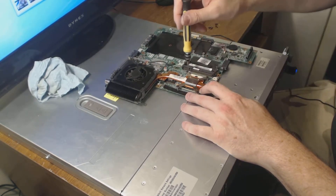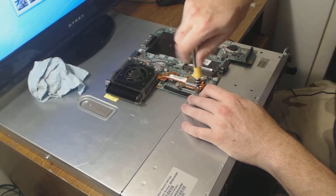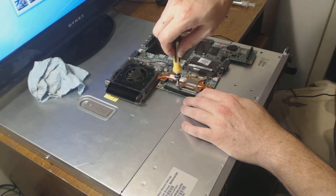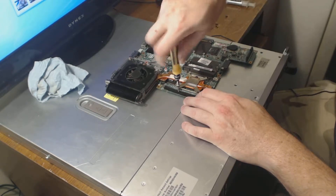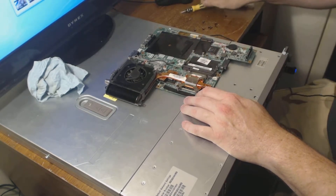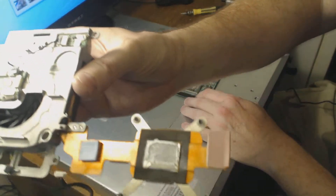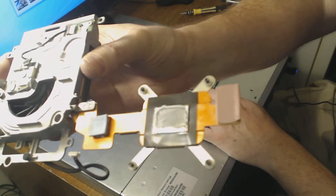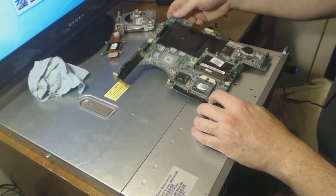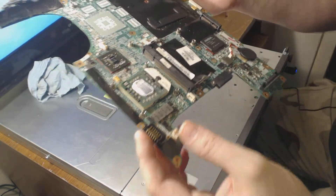All the screws are down, so I'm now going to remove it just to show you — and again, this isn't something you should normally do. Don't undo it once you've done this, because then you'll have to remove all that thermal paste and start again; otherwise you'll get air pockets in the thermal paste and it won't cool as efficiently, and you could have an overheating issue. As you can see, it has definitely spread around — I might have had a touch too much again, but it's not bad. That was just one diagonal little pass and it definitely spreads it around.